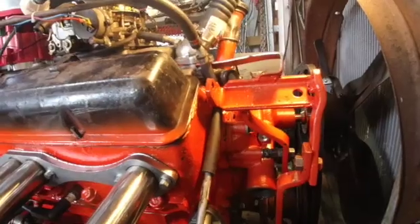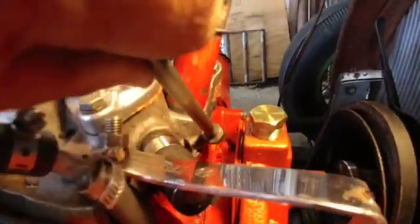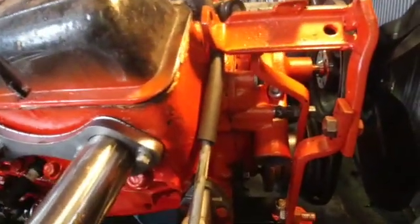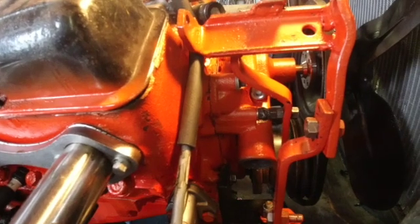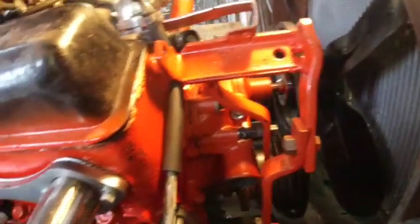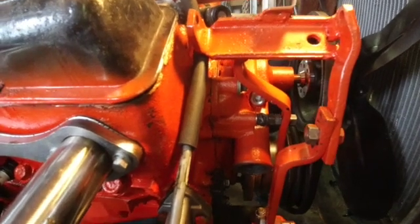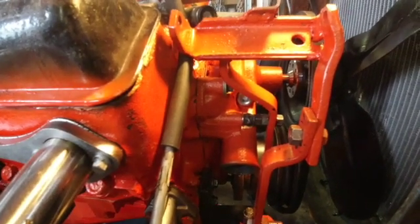It leaked. The new water pump did not have the gasket in the back of it, right inside where that plate is, and no one had ever tightened the bolts. So I took it a little bit loose and tightened the bolts and put it back on. I was trying not to have to wrestle it out from in there, and it still leaked. So I took it off again, took it back to the store. They ordered me another one, got it back.